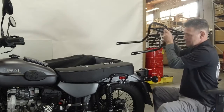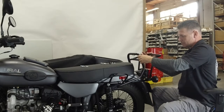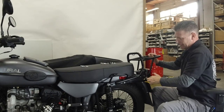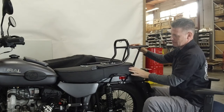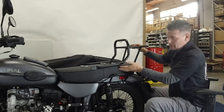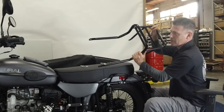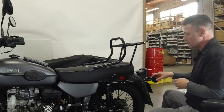If you try to snake the rack into position, you'll notice the turn signal stem actually gets in the way before you can get it past. And if you try to lower it down over the seat, you run the risk of marring or tearing the vinyl. You can either remove the seat, but if you only loosen the bolts and pull the passenger grab handles back, you're going to have those in the way. I'll show you how to clear the turn signal stem.